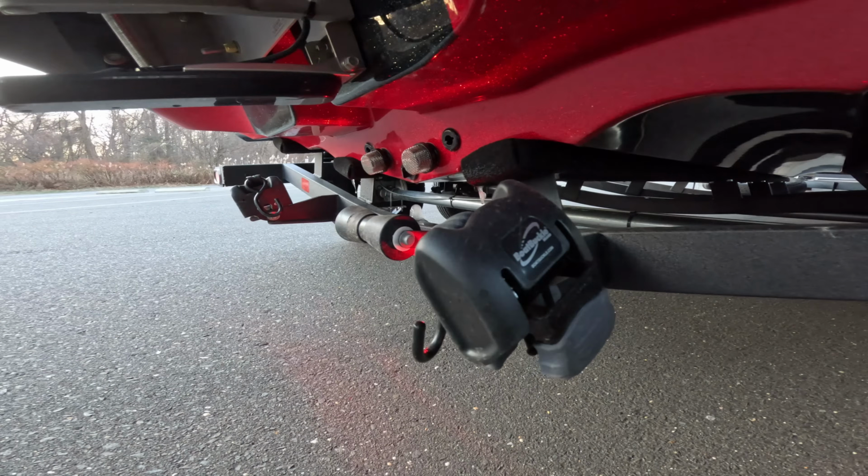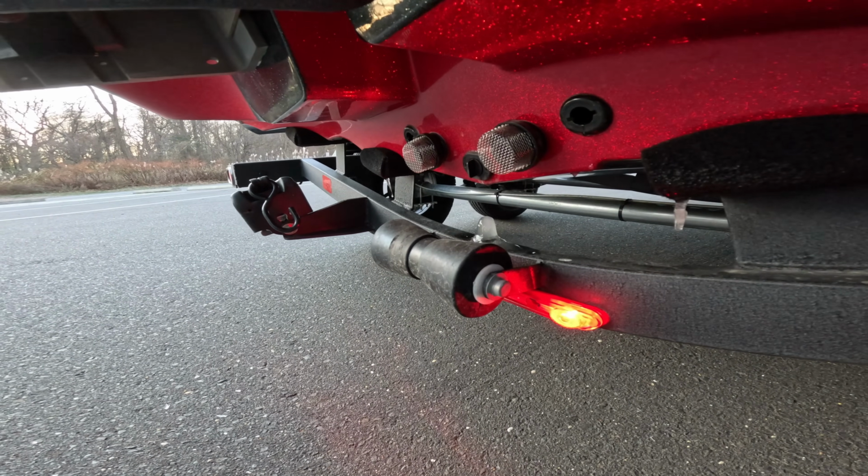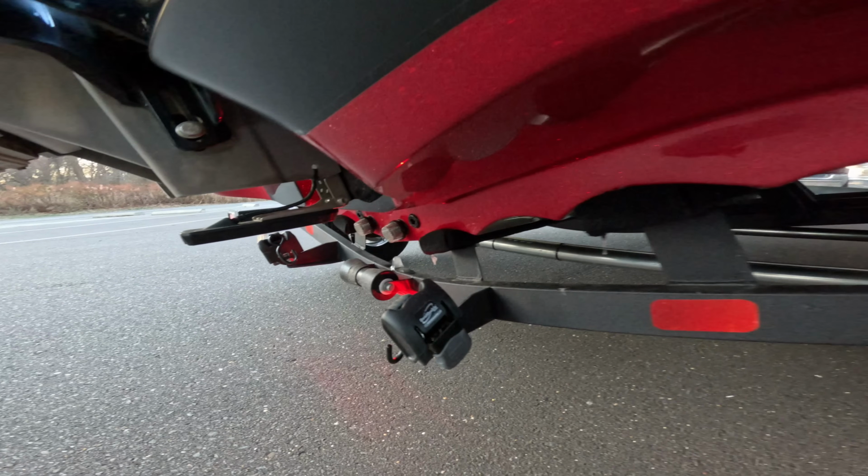And make sure, if you're going to go out again the second day and you're not going to be having your boat in a heated garage or a heated facility and it's going to get below 32 degrees, do not take your plug out. If you take your plug out and you try to put it back in the morning, it will be frozen and it will be impossible to get it back in there, and you'll basically have to try to finger the hole on the back to try to warm it up, or pour hot coffee down there. I've seen all kinds of different things guys have tried to do because they pulled their plug out and then they try to get it back in and it's frozen and they can't.